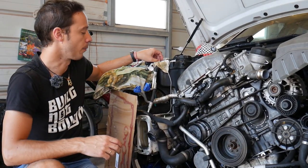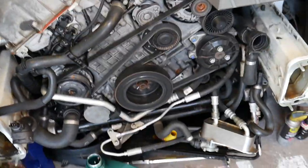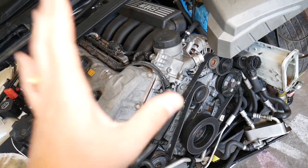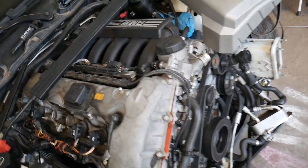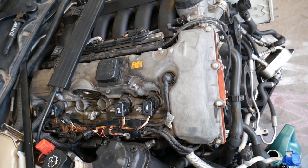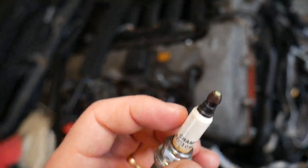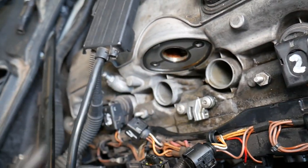Now let me explain what I'm talking about. It doesn't matter if you have a six-cylinder or eight-cylinder engine — the procedure is practically the same. This N52 engine, for instance, has been used in the BMW 6 and 7 series: E65, E66, E63, E64. When you change spark plugs and pull the spark plug, if there is a significant amount of oil around the spark plug on top, or you pull your ignition coil and there is a significant amount of oil, we will explain what can cause that.